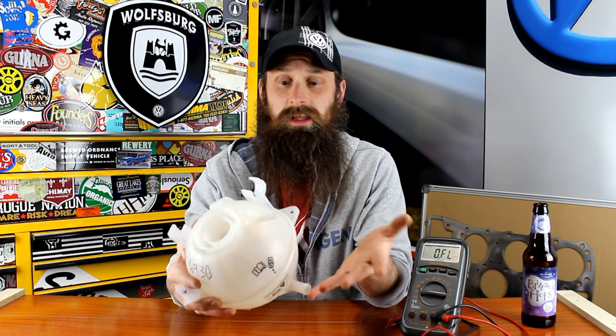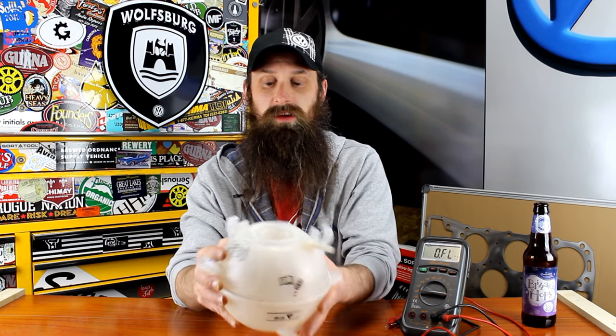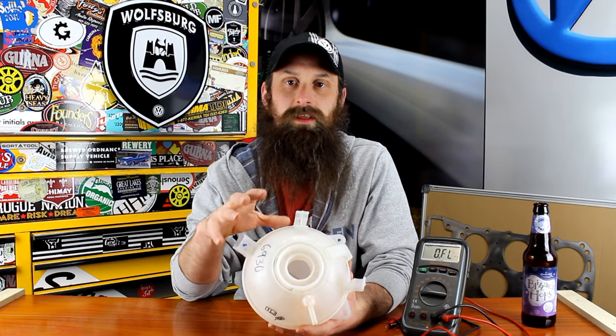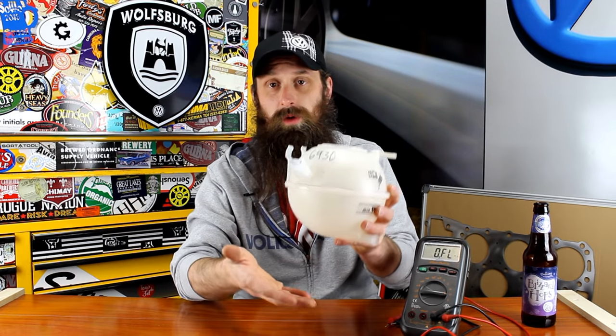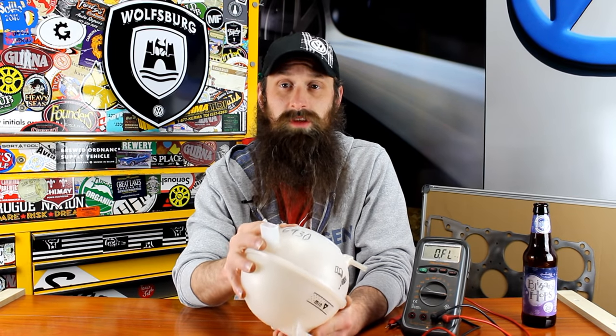So let's talk about how they fail. It can fail in a few different ways. Obviously it can leak — any of the welds or seams can fail. This little pressure tube can also fail, though usually when that happens it's more of an issue with the cap on top rather than the bottle itself. The most common way they fail is not necessarily a failure of the bottle itself, but the contacts on the inside get deposits built up. As the deposits coat those contacts, the resistance value changes. The cluster is looking for a certain resistance value, and if it sees something outside of that — either too low because the level is low, or too much because the contacts are corroded — it'll trip the red light.